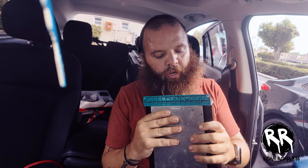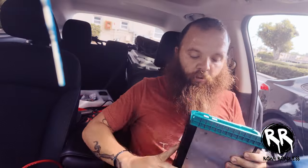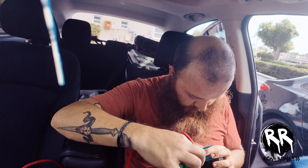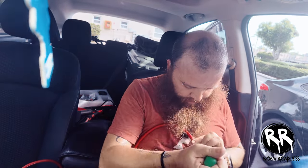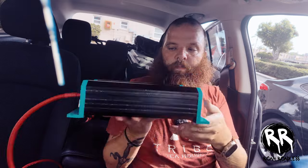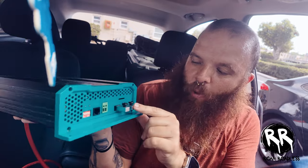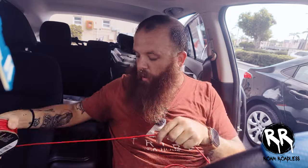I got the charger ready — just make sure you're hooking up to the right ends. One side says output and the other side says input. We're going to connect to the positive side of the input. Make sure that's nice and snug. Right here is where the fuse power comes in, and then the output wire comes out the other end to plug into the auxiliary battery. I'll use 14-gauge wire for the fuse power — you don't really need 4-gauge for it.